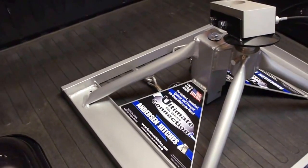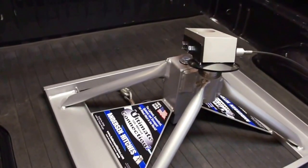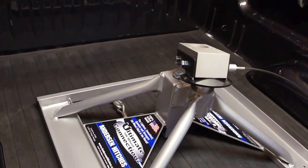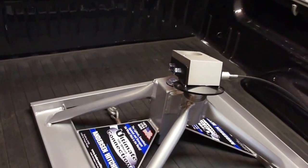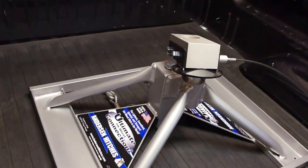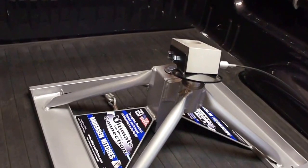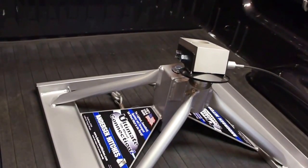So I looked online, and I don't remember the gentleman's name, but a solution that he had was to purchase the Curt 4-inch ball extension, and that moves the entire Ultimate hitch back 4 inches. So follow me here. I take away 8 inches by reversing it, and then I recover back 4 inches by using the Curt. And I'm going to put the Curt in a minute. You can see how that works. So what that does is I only end up moving forward 4 inches, and that was plenty.